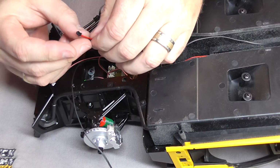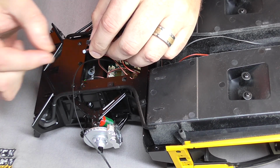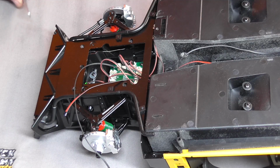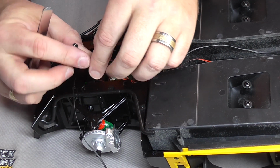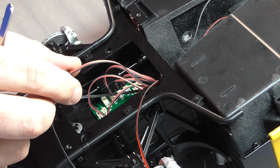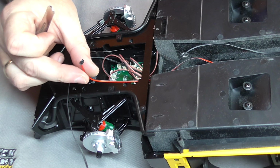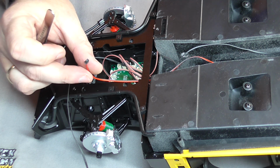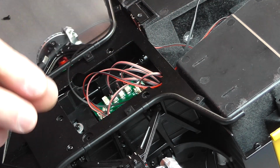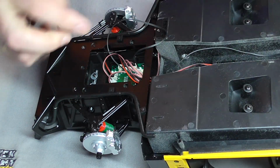So the black plug with the white backing on it, which is this one here, is the accelerator. That's going into number 3. So the black plug with the green panel now, which is this one here, this is the brake switch. And that's going into number 13. The engine switch, which is the black plug here, that's going into number 6. And then the interior light switch, this big one here, which is the red one here, that's going into connection 16. And there we go.